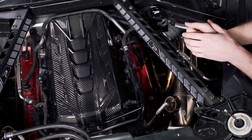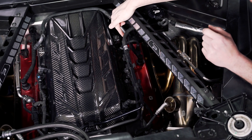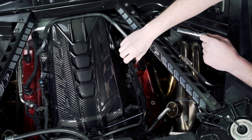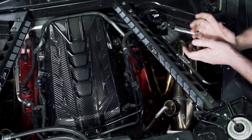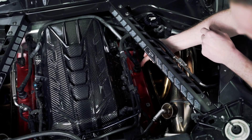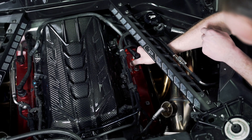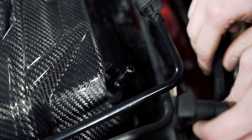Now we're over here on the passenger side of the engine compartment. We have to remove the PCV hose — that's this hose that connects here and then the one that connects right here going underneath the intake manifold. It's got a couple of plastic clips on it that we can undo — just rotate those up out of the way. You also have two down here that hook to the valve cover; it's a good idea to undo those too. They all have a button on the side that you just depress and pull up and off. Sometimes it can be a little stubborn — it helps to push down on them while you depress the clip, and they come right off. Then we're just going to fish that out of there.